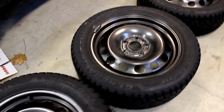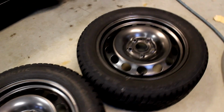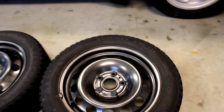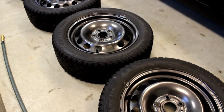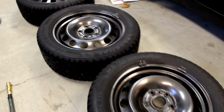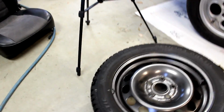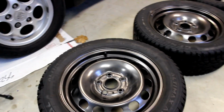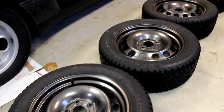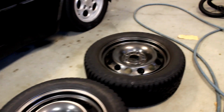Let's get started. The biggest thing that I'd recommend doing to your steel wheels is painting them if they're steelies. What this will do is add a coating over the bare metal that protects it from rust and from salt getting on it, which would lead to quicker rust. So definitely paint your wheels if you can. Check out the video on my channel, The Complete Guide to Painting Steelies, if you want to learn how to do a nice job and get a nice finish like on these wheels. But definitely painting them is a big help during the winter, and it'll protect your wheels from rust.